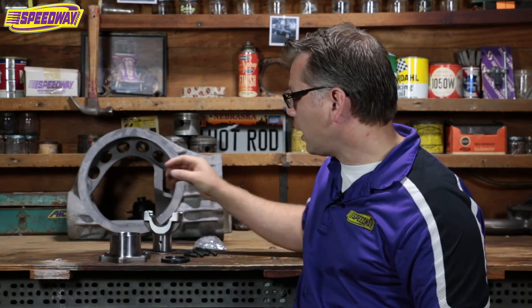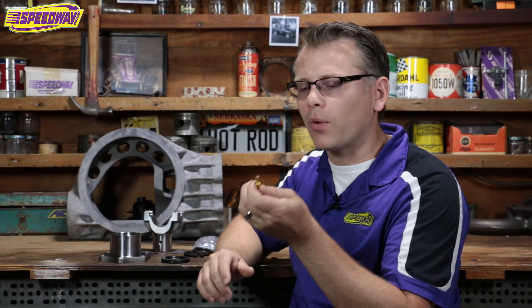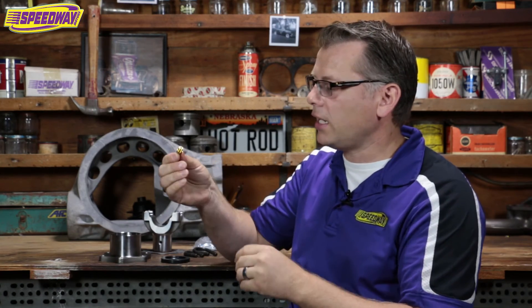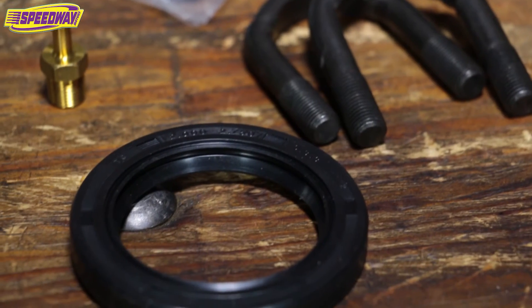The kit also comes with a vent, and that vent is very important when you make this conversion. You'll want to be able to vent the pressure inside the rear end. I didn't want to tear my rear end all apart just to install this vent. One option is a hollow bolt on one of the bells, but some guys have told me mixed results with that, so we don't sell the hollow bolt at Speedway — instead we recommend a typical vent. This one is ready to go; you just have to drill out your case. I did mine very carefully with what they call a magnetic drill bit, drilling it upside down so none of the shavings fell into the housing, then cleaned it out thoroughly through both drain holes to make sure no shavings got inside. It's a really great kit.